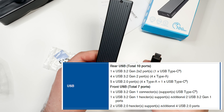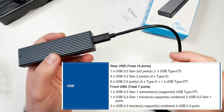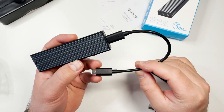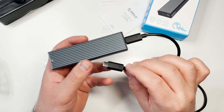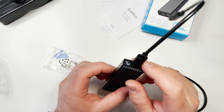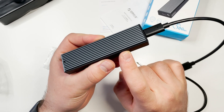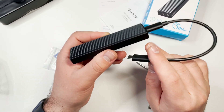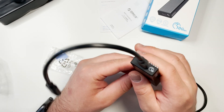My motherboard has a USB-C 3.2 Gen 2x2 port running at 20 gigabits per second, so there will be no bottleneck from the port side. The Samsung 980 SSD can deliver around 3,050 megabytes per second internally, so the bottleneck will be the 10 gigabits per second interface of this enclosure. Also, this enclosure only supports PCIe 3.0, so a PCIe 4.0 SSD will work via backwards compatibility but will still be limited to 10 Gbps.